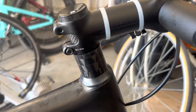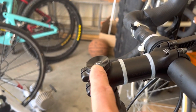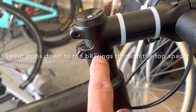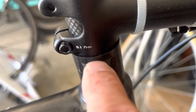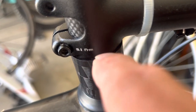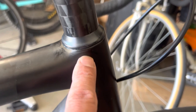One of the problems is sweating. I sweat a lot and do a lot of climbing, so my body leans forward, my face leans forward, and the sweat drips down onto the top tube. The sweat travels down and — see this spacer here — this spacer is not flush with the stem. The sweat slips through this top spacer and goes inside it, then continues dripping down to the top bearing and on to the bottom bearing.